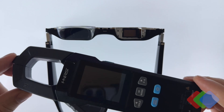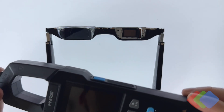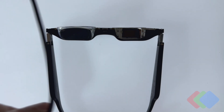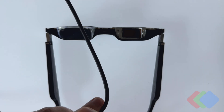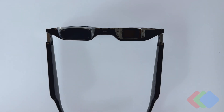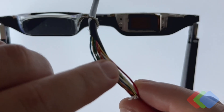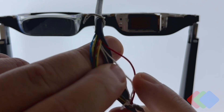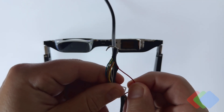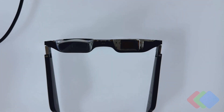The way we can do that is by getting a probe for the current as it passes through the actual device connecting cable. Unfortunately, if we use just the device cable as is, we have a shielded braid around the actual cabling. So we'll need to first cut into the cabling a little bit, as you see here, and get to the power wire — this thick red wire inside each of these cables. With our non-contact probe, we'll be able to measure the current flowing through this.